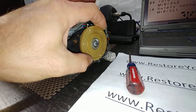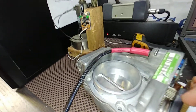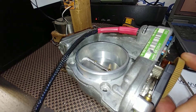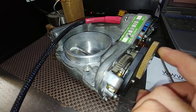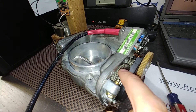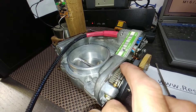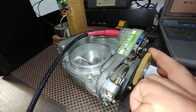So this is how idle speed is controlled. It keeps the plate where it needs to be because the clutch coil and all the gears are connected. This gear is connected with the clutch coil, with the clutch to the motor. That's why the shaft is connected via clutch coil to the gears.